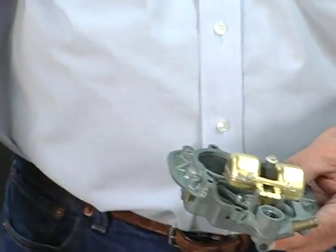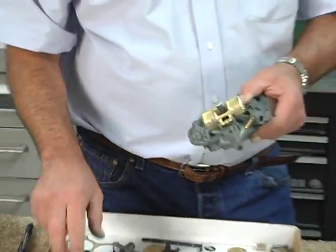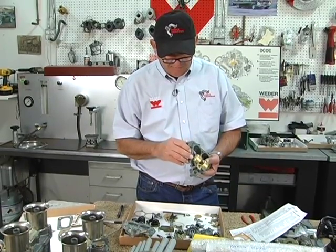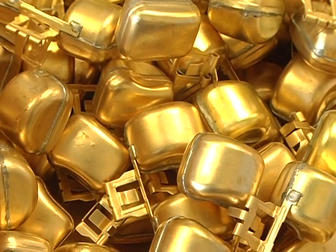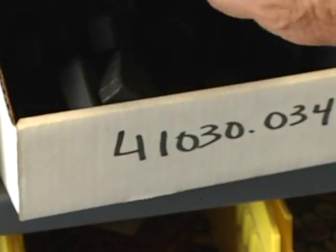And the brass float, plastic float, that's a debate. A lot of people don't like brass floats. They say they have a tendency to get a solder seam leak and fill up and sink. And a lot of people don't like plastic floats because they say that they'll absorb fuel and get heavy. And I just run whatever they came with.